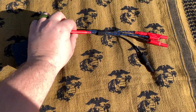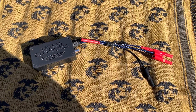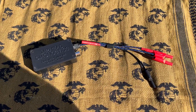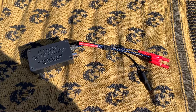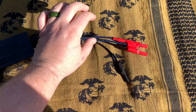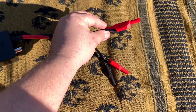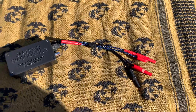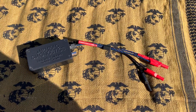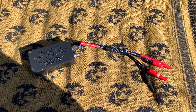It'll also come with a pull-down lead. This pull-down lead is current limited so that you can use it on pull-down circuits such as cam sensors or crank sensors if you want to test those sensors outside of the wire harness of the vehicle. You just take this lead, plug it into the back of your 5 volts out, and plug it into the back of your signal wire. This allows 5 volts into your signal wire but it's current limited so that whenever the system grounds out it grounds out properly and you'll be able to get a usable waveform.